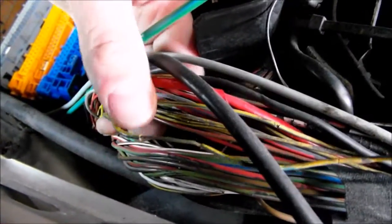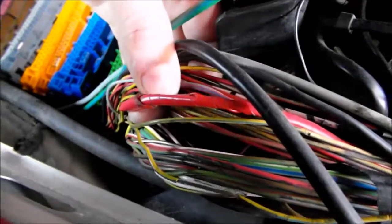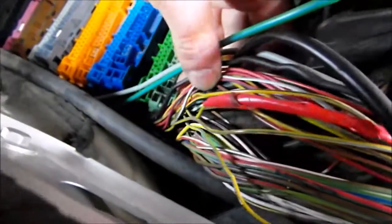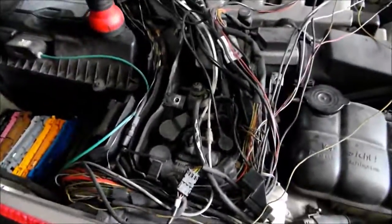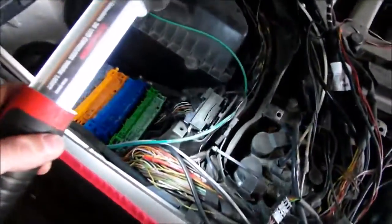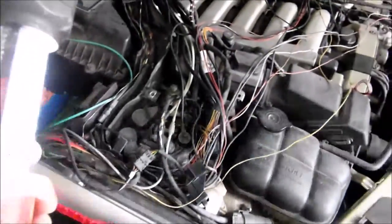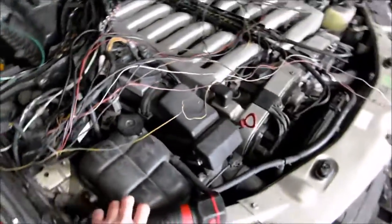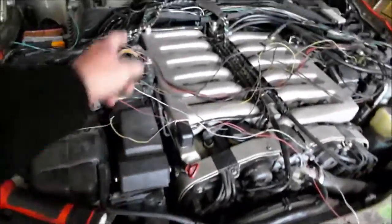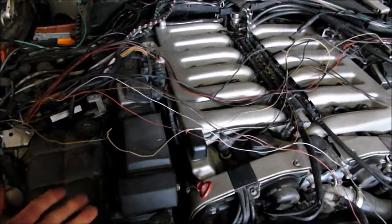As you can see, here's your wiring that goes from the driver's side mass airflow and goes all the way down. So they start shorting down in there and you will never see it. The biggest issue is that if your mass airflow sensor is not giving you the correct reading, there is a big possibility of the engine basically being flooded with gasoline, and you wash out your oil on cylinder walls.